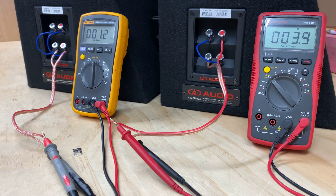I wanted to alert you to this, because a lot of installers had already started to notice and say, 'Wait a minute, this sub's not as loud as it used to be.' The reason they were thinking that is because the old ones had the bridging posts on and the new ones don't — they assumed there was a power issue.